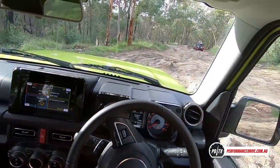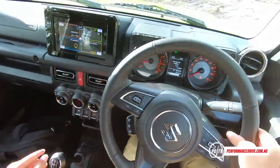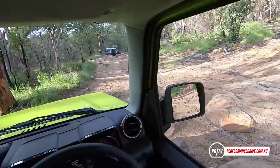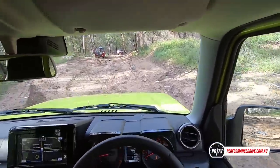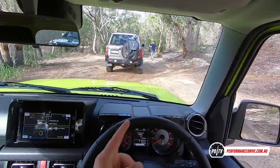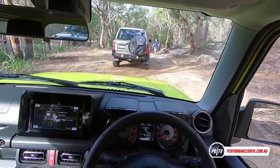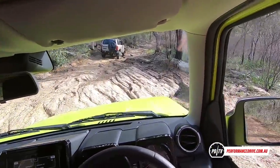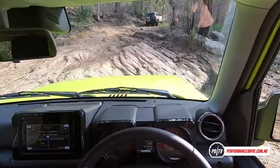Now at a different track in the manual version. Putting it into four-wheel drive — just move that lever down and the symbol comes up on the dash. Tires down to about 23 PSI. I'll do a couple of sections from inside the car then let my friend Ben from the office drive — he's a serious 4x4 guy and much better at picking lines. To start with I've left stability control on, but as you can see, limiting wheel spin also limits the engine's ability to rev and provide power.